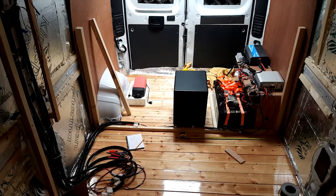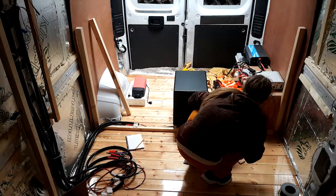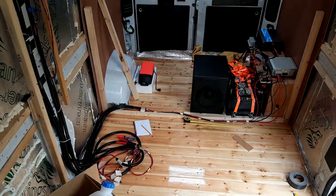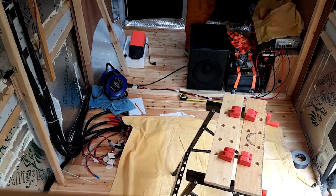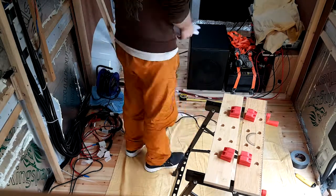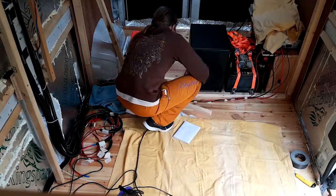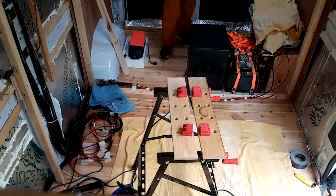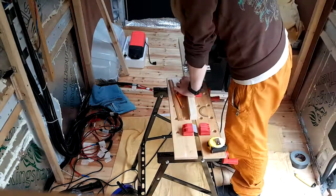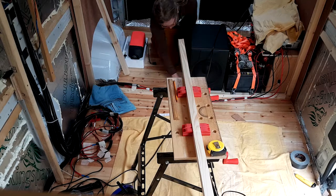Initially I planned to have my subwoofer in the very middle of the van for maximum quality stereo. But it's kind of silly and unnecessary because sub frequencies are omnidirectional, so a little bit of left and right isn't really going to make much difference. For most of my time having this sub it's been next to my desk, and that is noticeable because you have all the sound coming from one side — it's hard panned to the left, which isn't nice. But as long as it's roughly in the middle, you're not going to have any issue. And if I put it right in the middle, I wouldn't have had any space for my cool box, just a really pointless gap between my batteries and the sub. So I chose to sit the sub flush with the edge of the batteries.